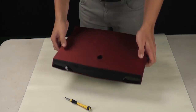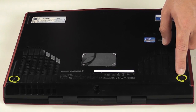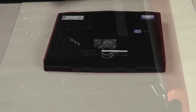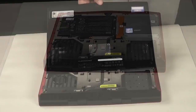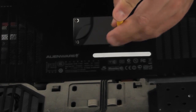Basic Disassembly. This is the bottom base door. To get access to the rest of the components, it is the first part you need to remove. Just locate and loosen the two screws securing it to the system, then slide the top left and top right edges toward the rear of the system to unlock the latches and remove it. If you need to replace this part, you may want to remove the name plate as well — unscrew the four screws, remove it from the old door, and install it on the new one.